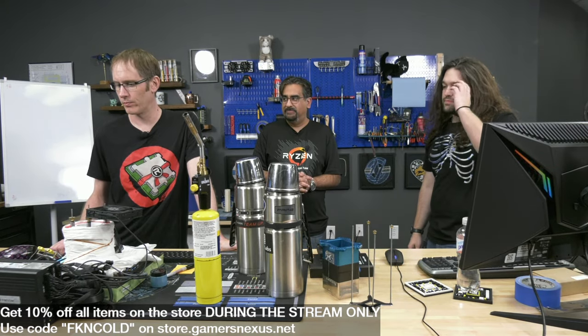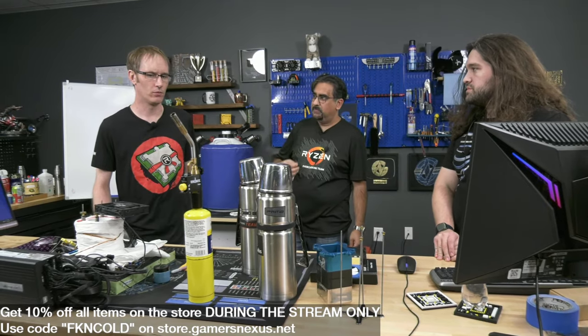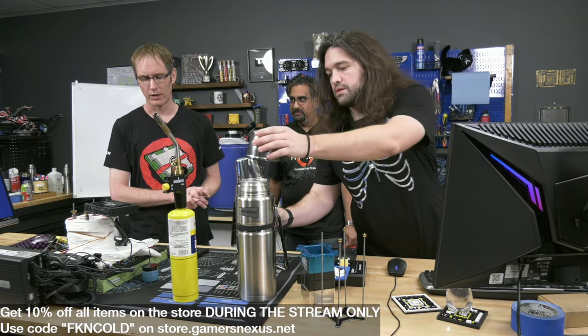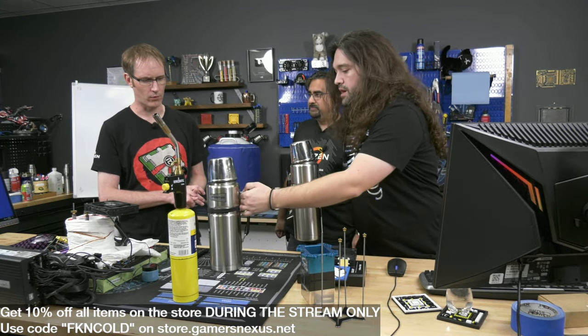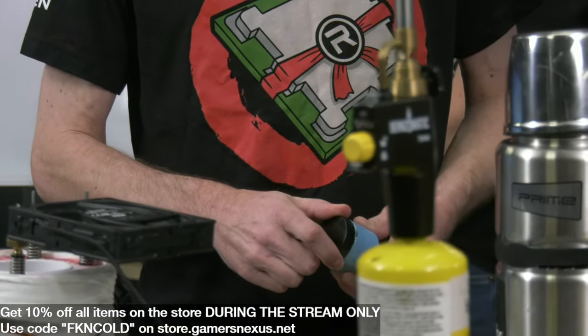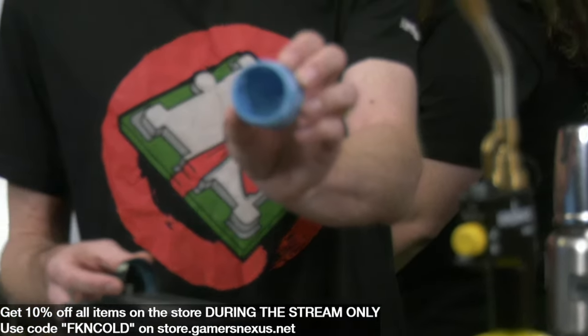Do you need a special kind of thermal paste for liquid nitrogen? Yes, some thermal paste tends to solidify and de-adhere when frozen - we call it crack. You can hear it happen, and if you heat back up it'll reset. In the lab we've used Dow Corning stuff for when doing a lot of swapping. Splave sent some blue paste - I've been using it on these systems. I call it smurf paste.